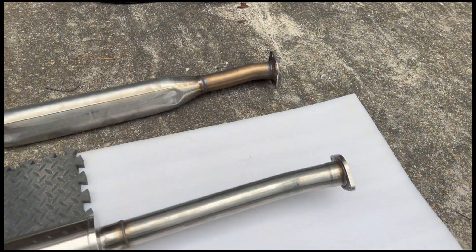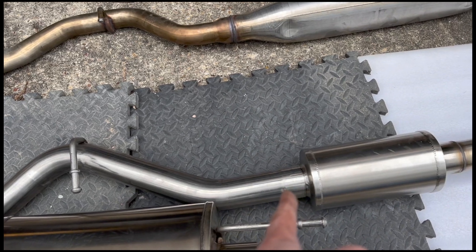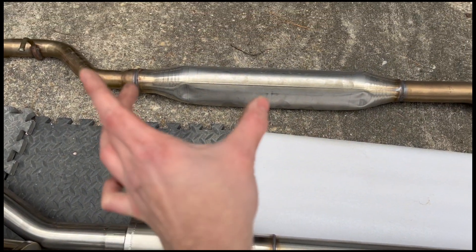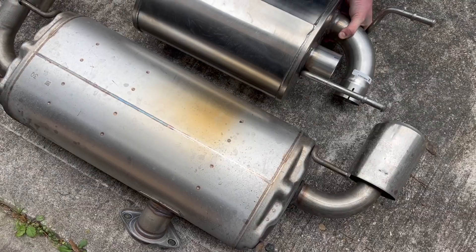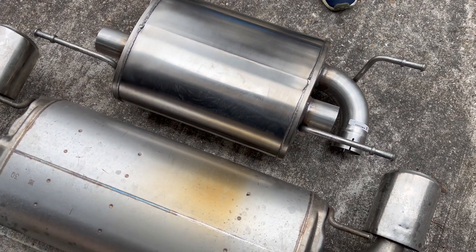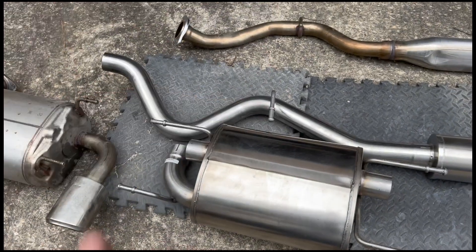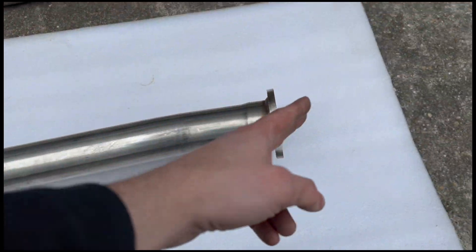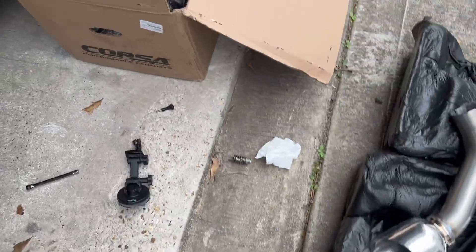Here is the new system we've slightly pieced together. It's a two-piece mid pipe - technically two separate pieces. It mounts up here with a C-clamp. This piece is a lot smaller than the factory one, so it should be less restrictive. The muffler itself is also smaller. Comparing old vs. new muffler, you can really see the difference. The car now has nothing from the catalytic converters back - hence cat-back.